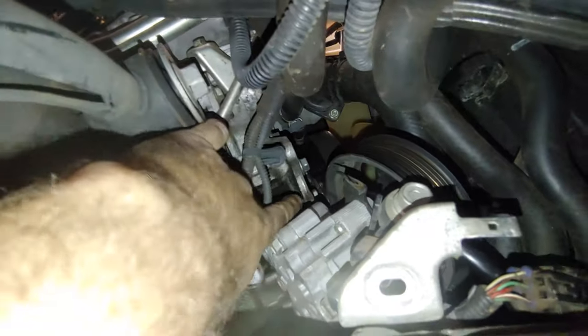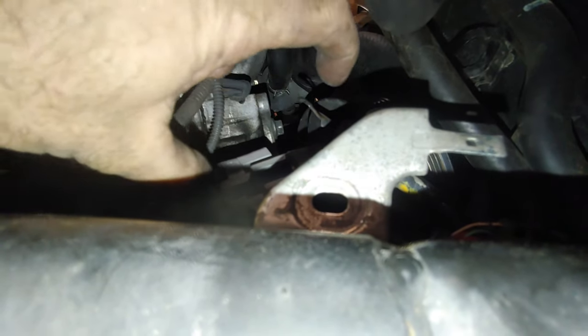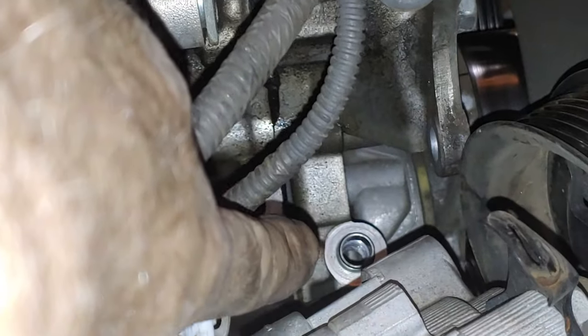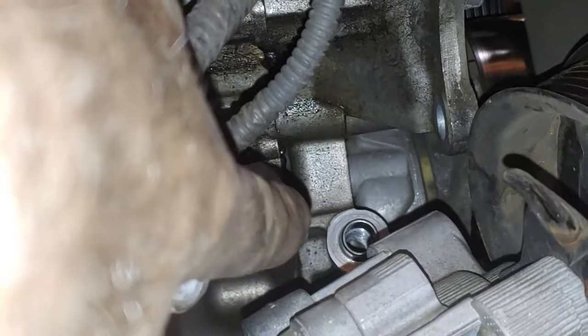Reach through past these hoses — you've got to take two bolts out of the alternator: a long one up top and a short one on the bottom. I used a short, maybe six-inch 3/8 ratchet with a deep socket first to break it loose, and once it was out some, I switched to a semi-deep socket. Then you can pry this off and move it out of the way, which lets you get to the two alternator bolts. One of these is actually a stud — I pulled the stud out, and there's a dowel pin in there that helps hold the alternator on.